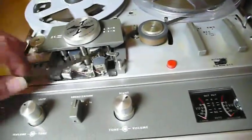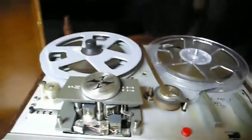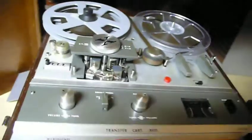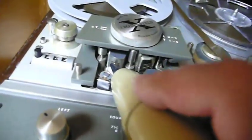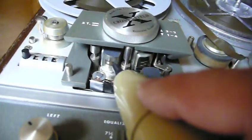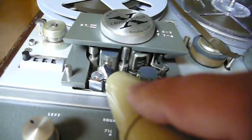Now this has a tape on it, so I'm just going to remove the tape for a minute and deal with it later. What you do is you get this tape recorder head demagnetizer. The instructions are on the back, but basically you hold the demagnetizer to the head of the cassette recorder device or player device for about a second, and then you slowly move it away.